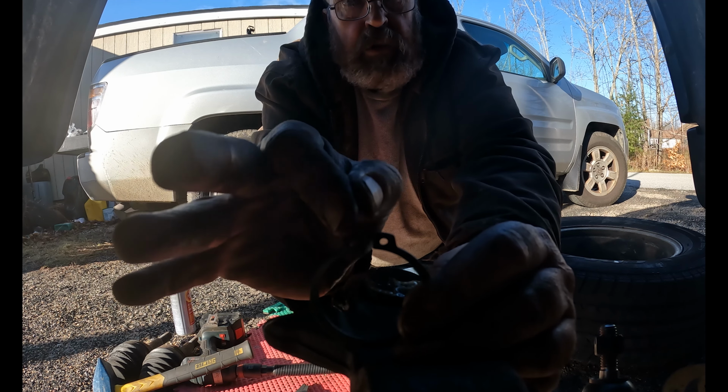These are snap ring pliers. They have little points on them that go into these holes. And by squeezing the handle, you open up the snap ring, which makes it large enough to go over